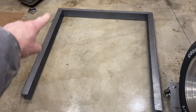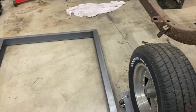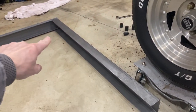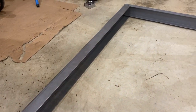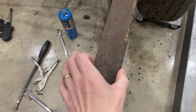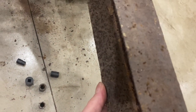You'll notice that this looks like that, and that's because that's what it's going to be. I actually had these things bent up. It's eighth-inch steel, four inches tall. These ones are 48 inches long, though I think I only need about 36 inches of it, and there's one for each side. This distance right here is two and a half inches on the top and the bottom — that's actually a little bit wider than on the actual car. On the actual car, the top is just less than two and a half inches, and the bottom is closer to about two and a quarter.